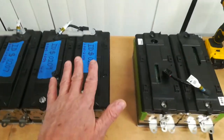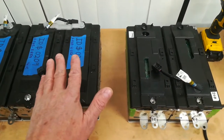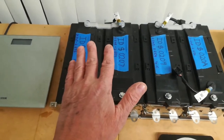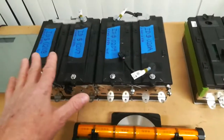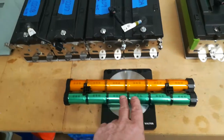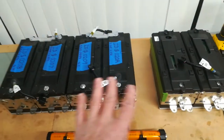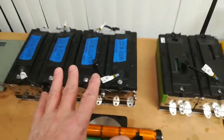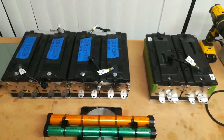If you go to standard or slightly higher voltage lithium and just use two blocks, that's going to be a 14.5 kilo penalty. If you then add another block, which I'll hopefully be doing later on, that's another 14.5 kilos. But the capacity of these is about four to five times the capacity of the standard nickel metal hydride - the OEM cells only have a working capacity of about three or four ampere hours, but these are 20 ampere hour, probably derated to about 18. So it's at least four times the capacity with a slight weight penalty.